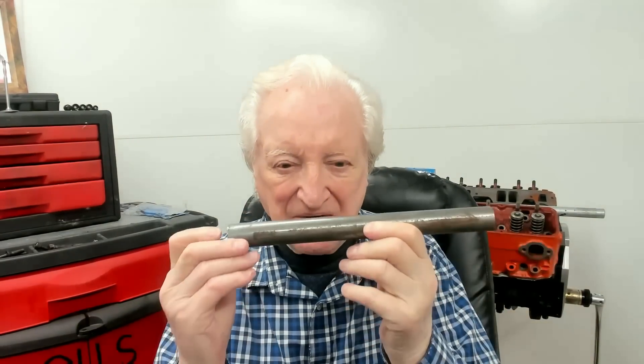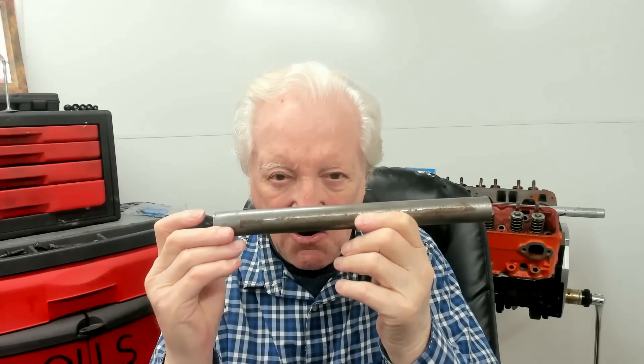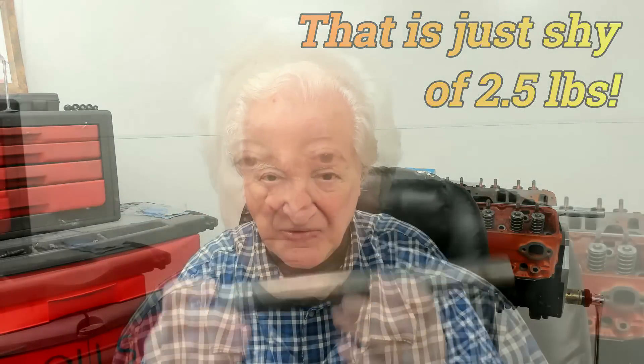In terms of weight, we're saving 280 grams per bob weight. We've got four bob weights, so our total savings comes to 4 × 280 = 1,120 grams. You may wonder what 1,120 grams of steel looks like — I'll show you. We've saved that much on our bob weights, and that's a substantial amount. If we took all the metal off directly opposite to the big end journal — about the center of the counterweight — then we would expect to take about 2½ pounds off the crankshaft, so our total reduction in weight would be 5 pounds.